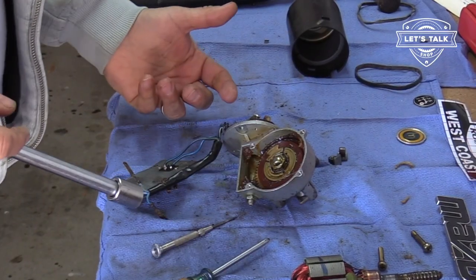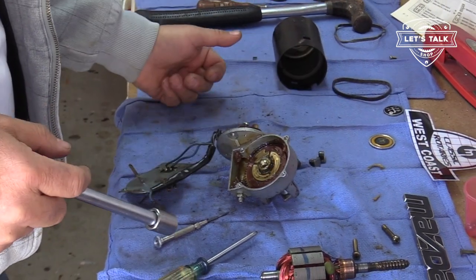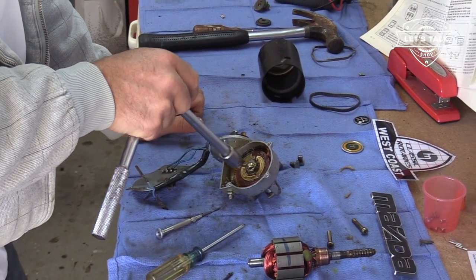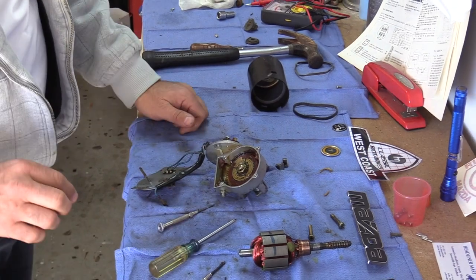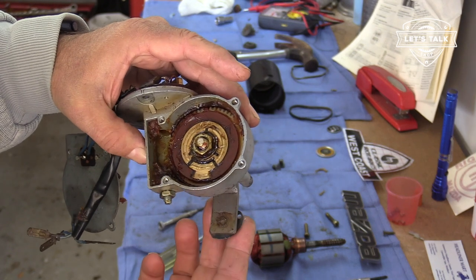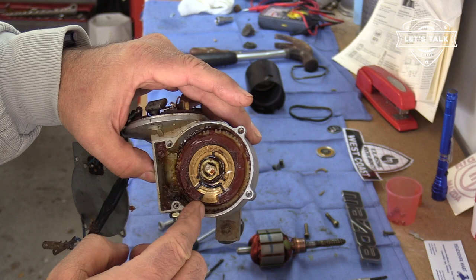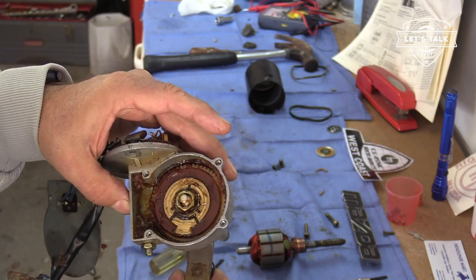If you crank the nut all the way down, then everything is frozen, because now you've bolted the wiper tang to this little housing. So it's a very careful balance. I don't know what the foot-pounds is, but you want everything to spin. You want to make sure that this tang, which is going to hold the wiper arms, and this tang here on the phenolic disc are lined up.